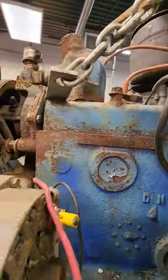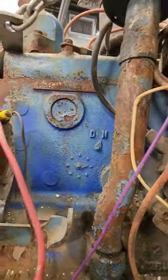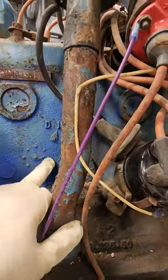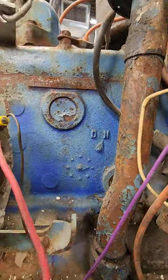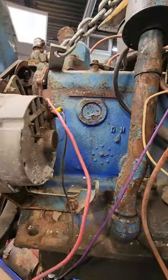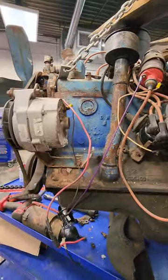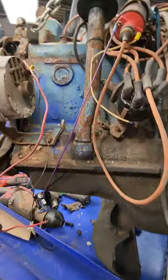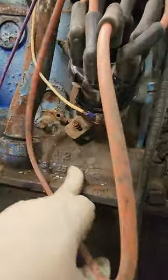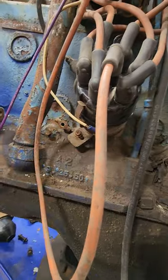P20 — so that's like a '50-'51 Plymouth, that's what this is. You can see the block was cast on the night shift at 2 o'clock in the morning. That was just production — basically so they knew if they had a problem in the factory with the casting of the blocks, it gave them an idea. This engine was made on 9-25 of 1950. Very cool.